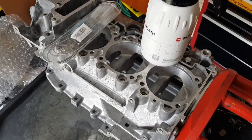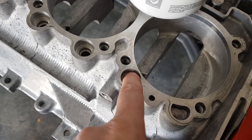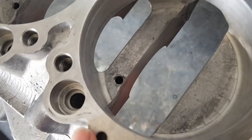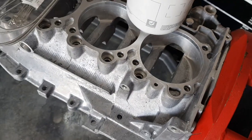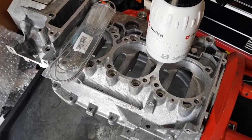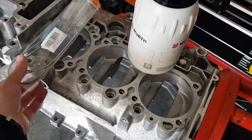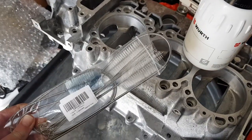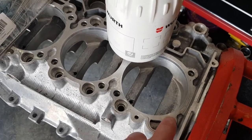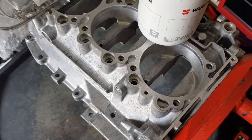The block is now ready for its final cleaning. All of the washers for the through bolts are out and any sealant has been cleaned out of the holes. The squirters are removed and it's also been through the ultrasonic cleaner again, so it's pretty clean. I'm going to give it a final going over with carburettor cleaner and a selection of brushes, going through every oil way and every passage with plenty of carb cleaner to make sure it's all well scrubbed out, including the holes for the oil squirters.